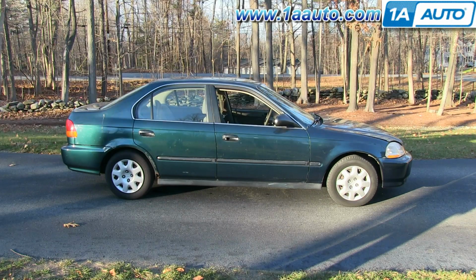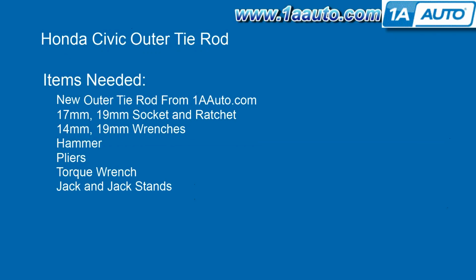In this video, we show you how to replace an outer tie rod on this 1998 Honda Civic. We show you on the passenger side, but the driver's side is the same procedure. The items you'll need for this are a new outer tie rod from 1AAuto.com, a 17 and 19 millimeter socket and ratchet, a 14 and 19 millimeter wrench, hammer, pliers, a torque wrench, and jack stand.